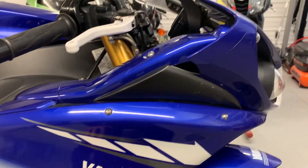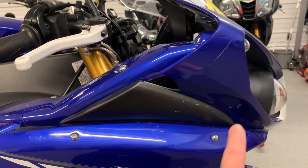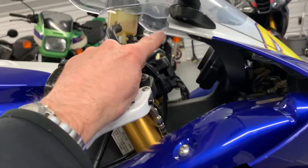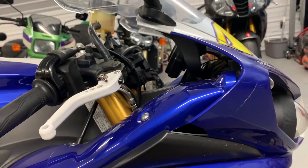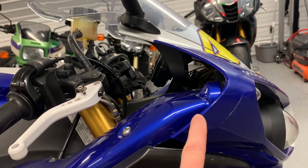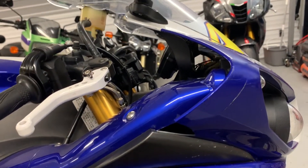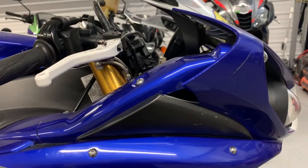She's a little tired. She's fallen over at some point — it doesn't look like a moving fall, more like a tip over. So we've got a piece of the fairing missing in here, and there's a couple of cracks right up here. There's also a missing piece of the upper fairing. The plan is we'll either plastic weld or use plastics to fix it. I've actually purchased a replacement upper fairing off eBay — shipped from the US to Canada, about $100 — and I'm going to take the pieces out of it and graft them in here.